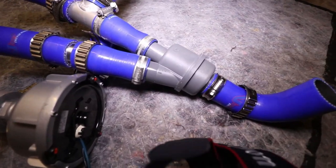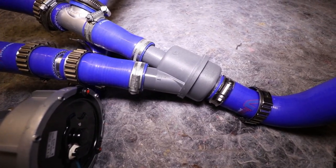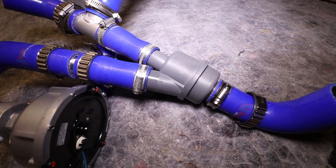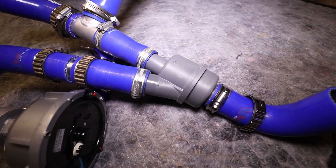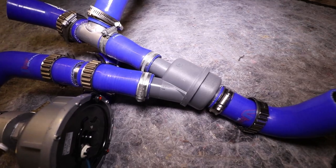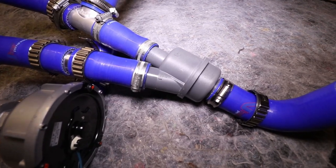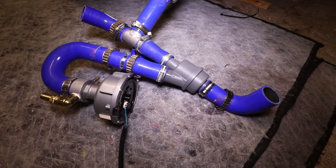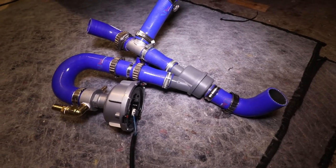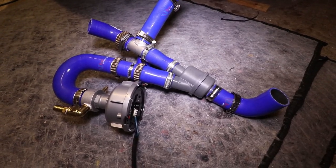A couple of points on the thermostat — this is a genuine Land Rover part. There are a few different part availabilities for this and I would definitely recommend this one, although I've not tested it yet. I did test a black one — same part number but with a stiffer spring on the bypass — and a creamy white colored one which was supposed to be an OEM identical replacement, but the creamy white one definitely has a stiffer spring. So this is the one I would recommend.